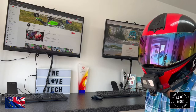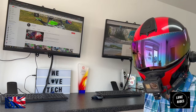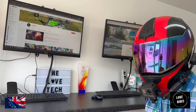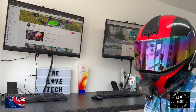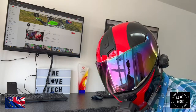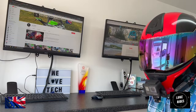Her front brakes — she's used up all the material on the factory discs, and there's now a judder on the front brakes. So we're going to replace them here at Luke Rides, replacing the front discs of the Superbike with EBC Superbike brake discs.